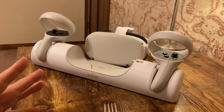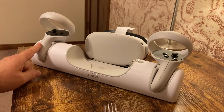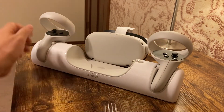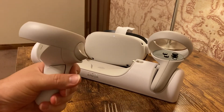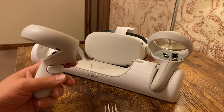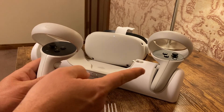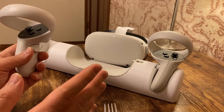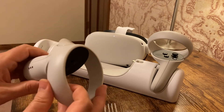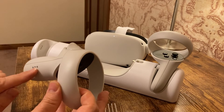The biggest thing to share: I can't tell yet if it's due to the rotation of the silver pads lined up with the prongs in the controllers, but I had to actually swap the batteries from one controller to the other. I had a condition where my left controller was getting super hot — kind of freaky — and I was getting a constant blinking amber light. I've read online, though there's no definitive info from the manufacturer, that a lot of folks say to switch the batteries — switch one battery over to the other controller. Apparently the batteries can be controller-specific. I did that and it worked; I haven't had the problem since. I'm not sure if it's also due to the slight rotation of where those silver pads are and how they line up inside the controller to those actual prongs.